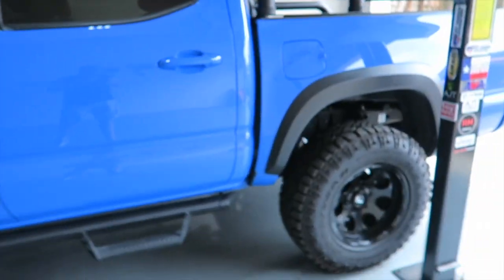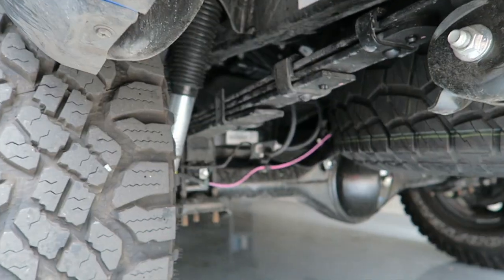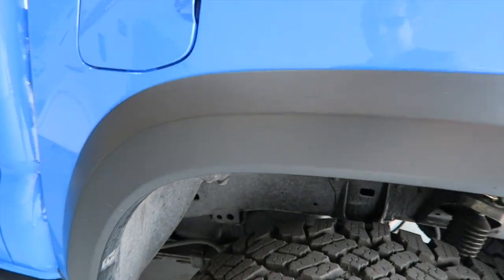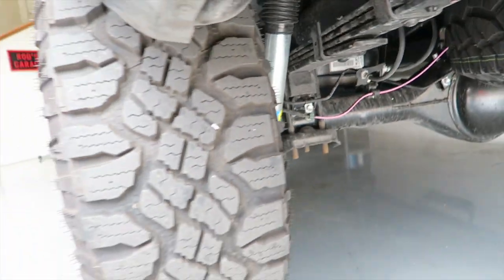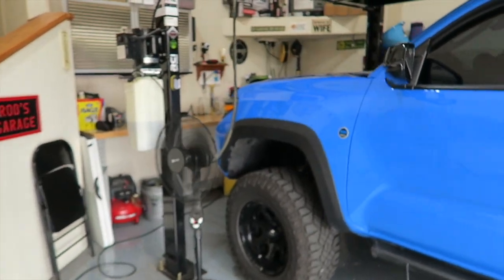So eventually I got to what I have now, which I've referred to on the channel as a kind of hybrid lift. It really is a block and spacer lift with new coils and different shocks. Showing you what I have here in the back, I've got Bilstein 5100s — you can see them right there, silver — and they're awesome. I did keep the two-inch block, and you can see it right there next to the shock. That's from my second lift.